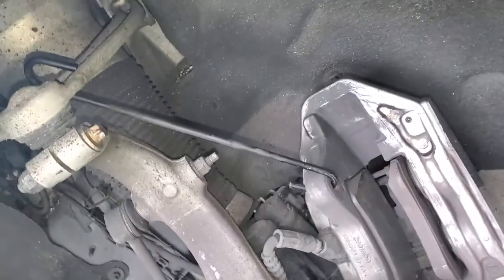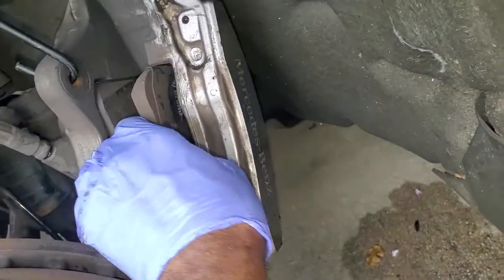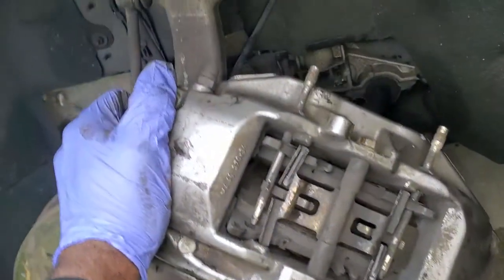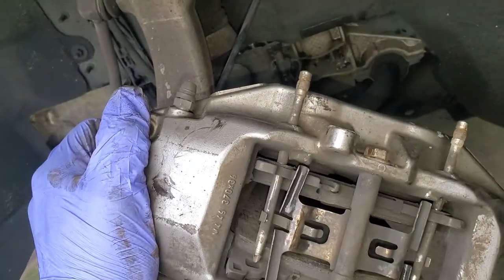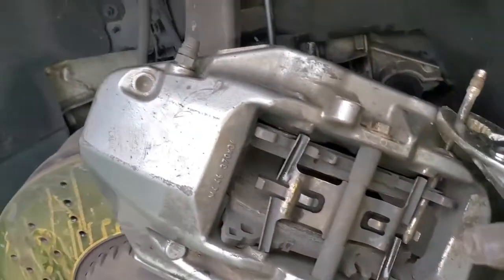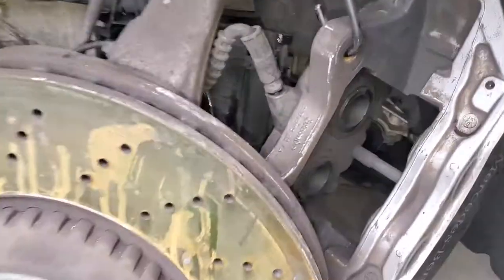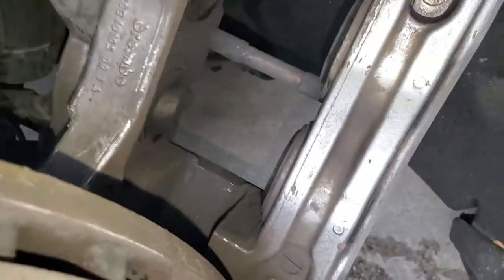So basically that's the caliper. That's the hook like I was talking about earlier. We're going to take the brake pad out — we're going to remove the pins first and then the brake pad will just slide right out. Here's a better view of the two pins sticking out. I'll just pull them out with a little wrench. This is what I'm actually talking about — using this tool, putting it in here, and just pulling it straight out. Just like the other pin came out, the second one coming out, and then the brake pad will be loose to take out. We have the pads out, and now we're going to take the compression tool and push those pistons back in so they're flat and level so we can insert the new brake pad and put it back on the rotor. That's one of the reasons why we left the cap off — so the fluid can actually push back out a little bit.